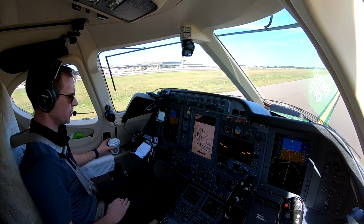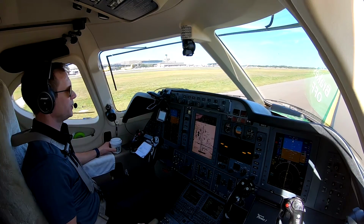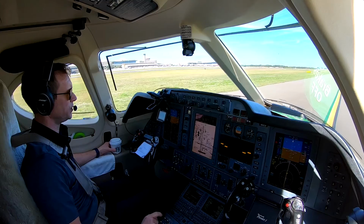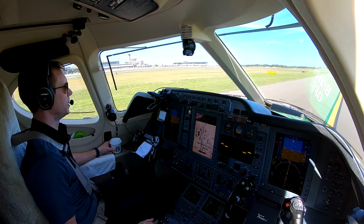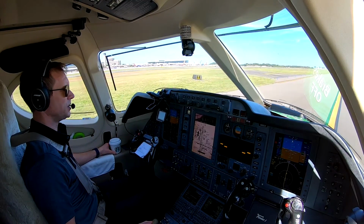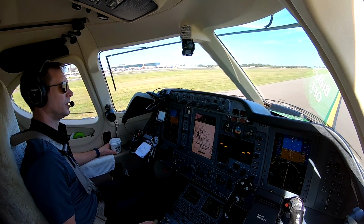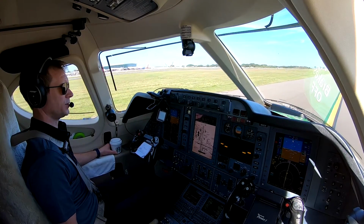So the reason why I was in maintenance was I kept getting a bleed air issue. See, in a jet airplane, for as far as heat in the cabin, and you need heat in the cabin because it's a pretty harsh environment up at altitude. It'll be negative 50 degrees Celsius outside, which at that temperature is pretty close to negative 50 Fahrenheit. They almost match up right around there. But it can get darn cold in here if you don't have a heater. So what they use is bleed air, they call it, which is they siphon just a little bit of that hot air coming off those jet engines. And it goes through some different environmental type of equipment, and then it's distributed into the cabin.